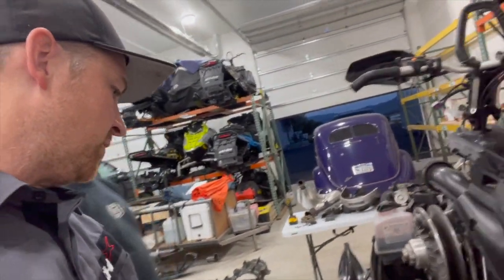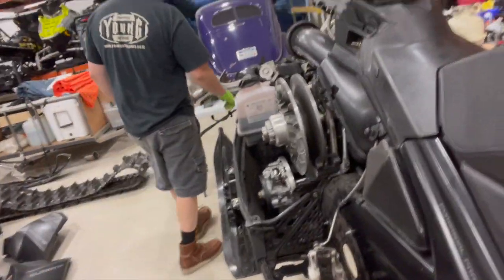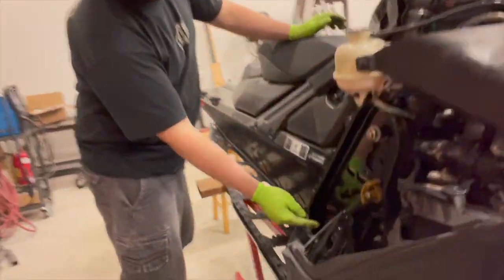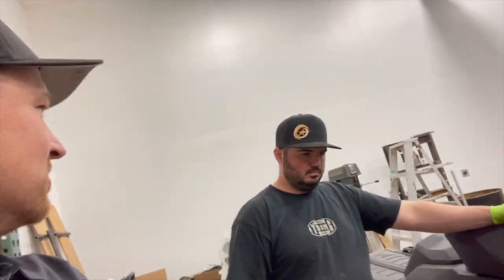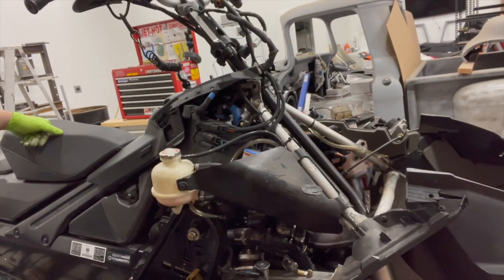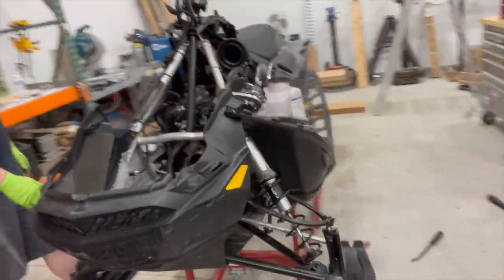Yeah. Just the hardest part was getting the puller behind the brake assembly. I think once we were able to pop something, we just had to get it out of this bearing, right? Because it's not really pressed in. As soon as it popped out, there was room to get the puller on. Yeah. So it's, I mean, honestly, not too bad. No, you just make sure you take all the chain case off. You don't have to take the top gear off. We're just doing the gear down. You don't have to take all this off. Yeah, we were doing that for other stuff. But yeah.